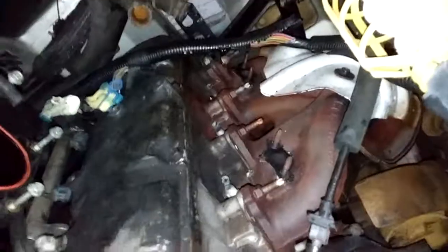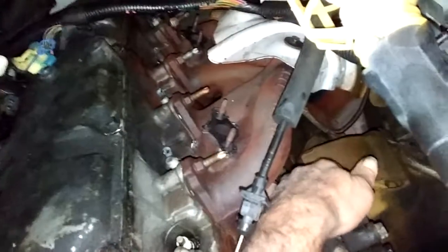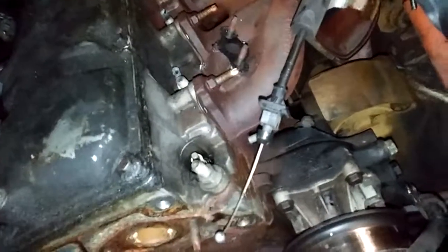Catastrophic failure right here, same thing on the back. This tube that comes down right here — the tube just had a tear in it. I went ahead and tore it off. I'll show it over there, but that's where the water pump hose fits. It's almost like a thermostat housing — the hose just shot on that right there.